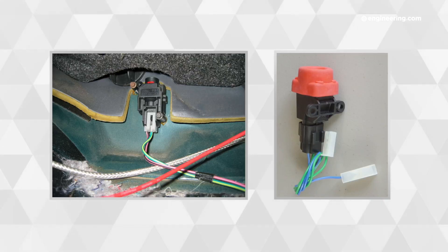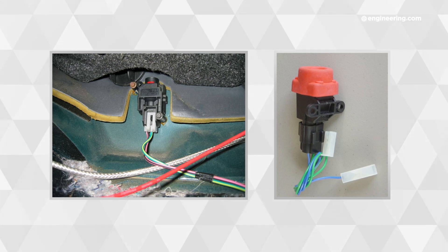So why did this one fail? It was installed in an inertia switch — a safety device designed to shut off power to the fuel pump in case of a collision. That switch is installed on the passenger-side toe board in a location where it's exposed to dust, dirt, and moisture. It doesn't take much to corrode the contacts, and with corrosion comes resistance, and with resistance comes heat. Can a major OEM simulate things like a kid with muddy boots kicking his feet up under the dash? Probably not, but today this kind of thing had better be an exceedingly rare event. This is a highly competitive industry, and I've never seen this happen on my Honda.